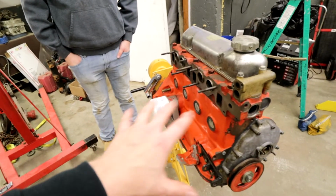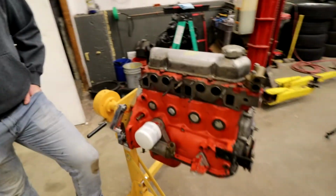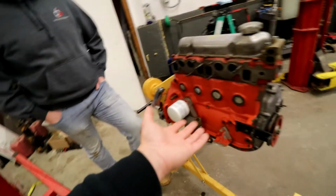What's kind of intimidating are all the coolant hoses that I'm going to have to hook up. Honestly, we might just tap and die those out and put AN fittings and AN fitting line and everything. Oh, that would be so expensive. AN fittings are so expensive. Yeah, but if we can't get the copper to work, it might be our only option.